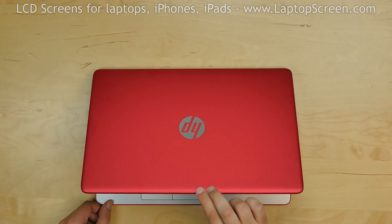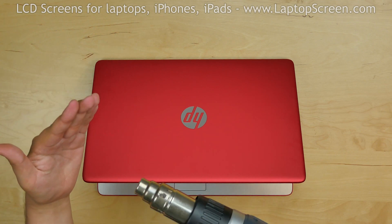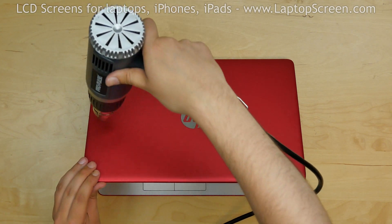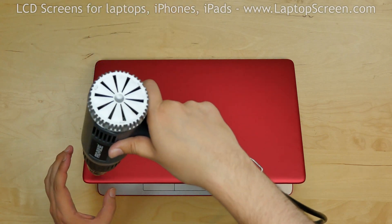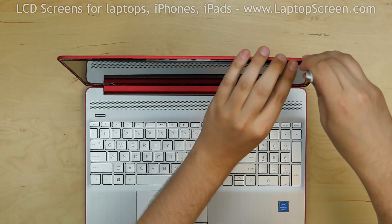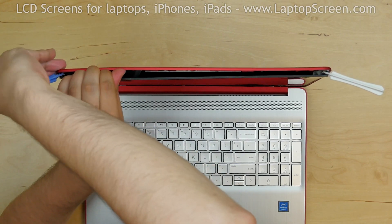You will need to use an industrial hair dryer, also known as a heat gun, to soften the bubble gum. Use your hand to feel the temperature as you evenly warm up the two edges — and if you start screaming, the temperature is simply too high and you should try moving the heat gun further away. Once you get bored of waving the heat gun around, try inserting a plastic pick behind the LCD on the right edge and do the same on the left edge. This applies pressure on the bubble gum to help with separation.